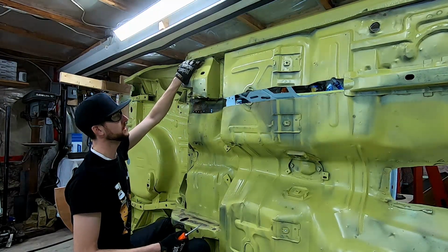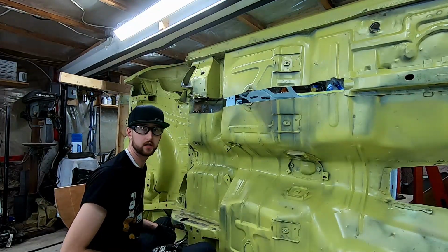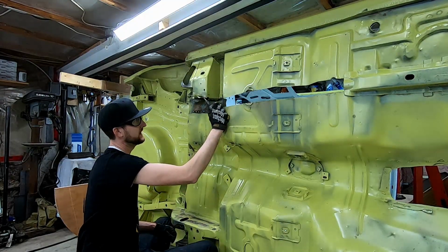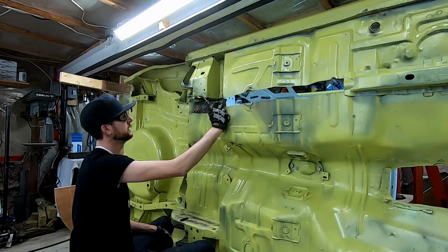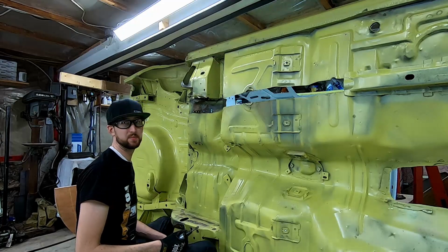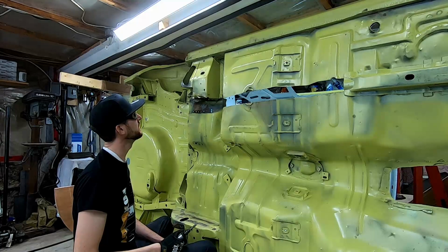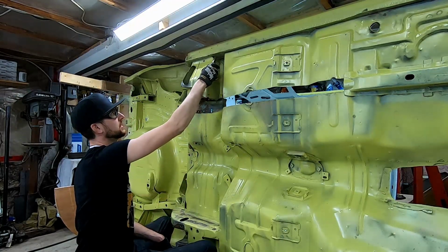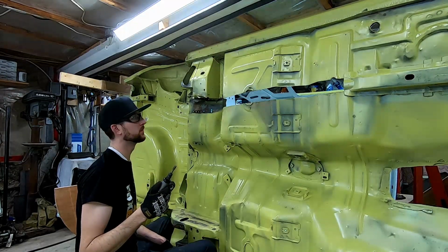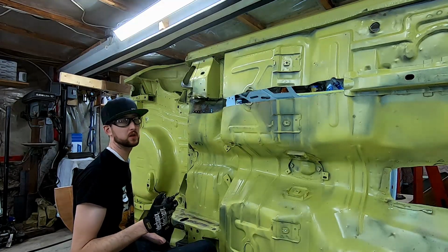Because all these spot welds up here, not going to be nice. You can't get at them with the tool. I tried a carbide bit, one of these, up on an angle for a spot weld, and I probably had 10 minutes to get, well, that's maybe halfway through one, and there's probably 10 or more that have to be brought out all along this upper edge. So this is not an effective tool for that. Good theory, just not a quick enough process.